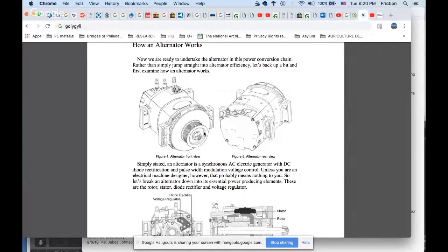The alternator you're going to replace, if you do upsize, this pulley matters. The RPMs of the engine at idle control how much energy is coming out of here. So at idle, your alternator would ideally like to be able to run the air conditioner, the heater, not together obviously, without putting a negative drain on the battery. You don't want to have a negative drain. You'd like to know the baseline of this alternator at regular idle RPMs of your vehicle. It was designed to run all those things. Turn on your dome light, turn on your headlights, turn on your air conditioner. Well, the answer is kind of yes.